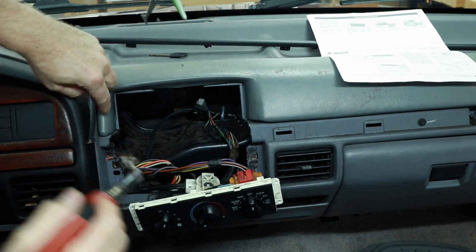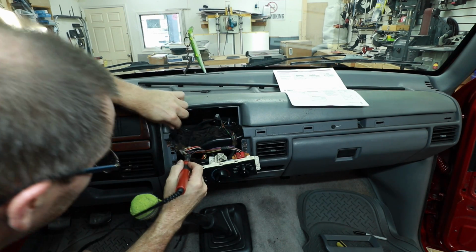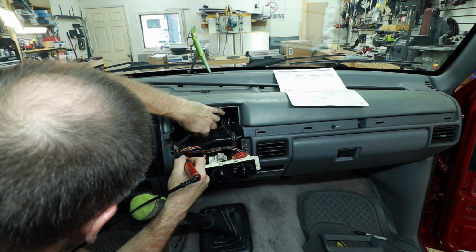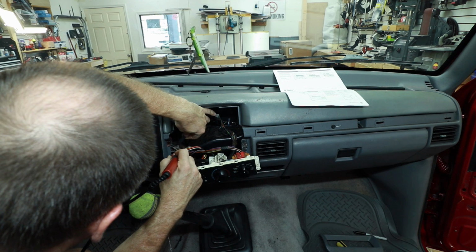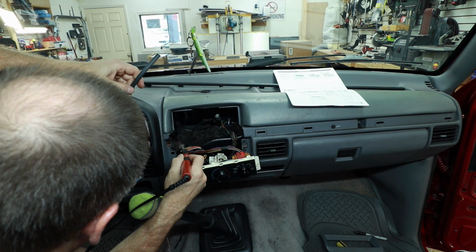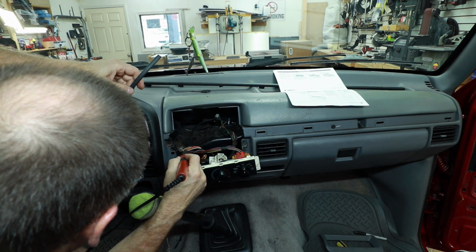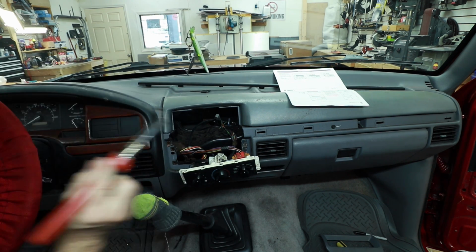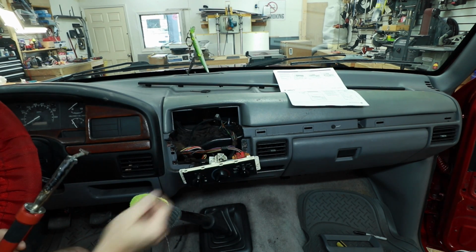Now with that little hole that we have where we bossed the piece, the iron will actually melt in raw plastic. Go ahead and add in a small piece. It just heats it up slowly, just kind of work it into that staple that we put in there. Be careful not to heat up the staple too much. Kind of like bubble gum, you just kind of pull and stretch it and fold it in on itself. And then you can shape it into whatever you need it to be. That staple, it's going to wrap itself into that staple, and once it cools, it'll be one solid piece.